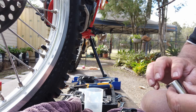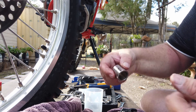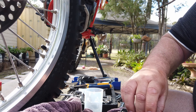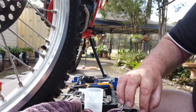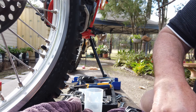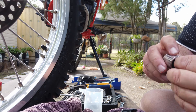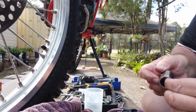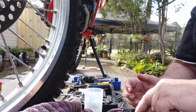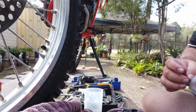Now it's time to put the pistons in. Despite how you saw the other ones come out, you would think logically to put the hole in first — no, that's not correct. Actually put the bottom of the cup into the hole first. Make sure it pops in straight — and look at that, it just basically slides in, no effort at all. It felt really, really good, so that's telling me it's a perfect fit. A little bit more grease around that one. There should be a little bit of resistance but not a hell of a lot, because you've got to go through a couple of seals. And there we go — see how easy that popped in? Piece of cake.